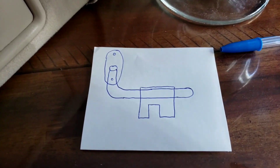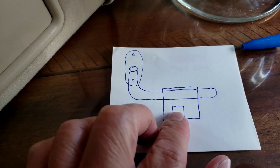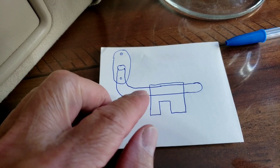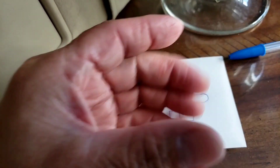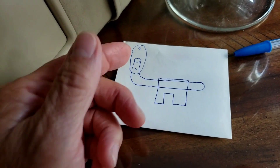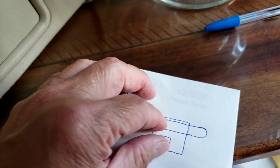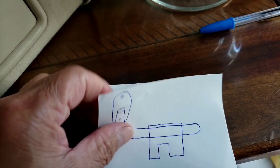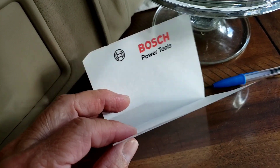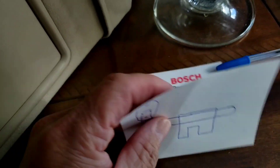Here's the bracket — it goes this way, then there's a metal bracket here, and this gets sandwiched between the two halves of the visor so it holds it and doesn't spin. The shaft spins and that's the whole idea. What happens is that under tension, when the visor starts to break and the two halves separate, that bracket just keeps turning around — and that's the little clicking sound you hear.